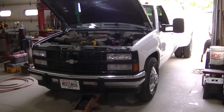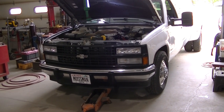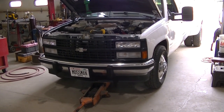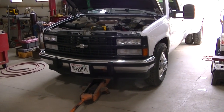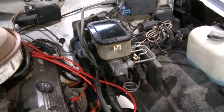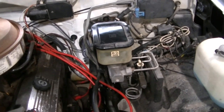I'm having an issue with this conversion. The brakes work when you hit them, but the problem I'm having is the brakes are sticking — they're staying on even when I don't press the brakes. I jacked it up just to confirm that was happening and it is. The front seems like it's sticking worse than the rear. I'm a little baffled on why I'm having this problem. Also, this hydro boost is actually leaking worse than the other one — it's leaking pretty bad.